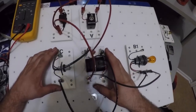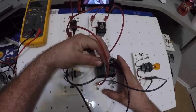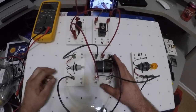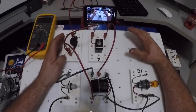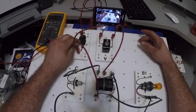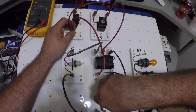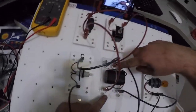Okay, now I know, because I'm working with a 5-pin relay, I have a wire coming out here at C, have a wire coming in here at E. That's my circuit in a nutshell. Now something I can automatically assume, I've changed it around from the previous videos, but I've got my power coming through the fuse and out these two wires right here. One comes up to the switch and one comes directly to E on my relay. Okay, that's constant power at E, switched power at D.